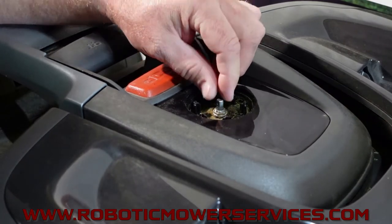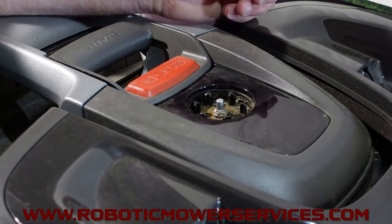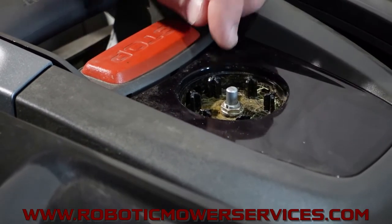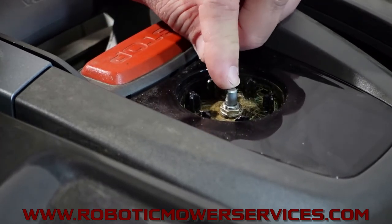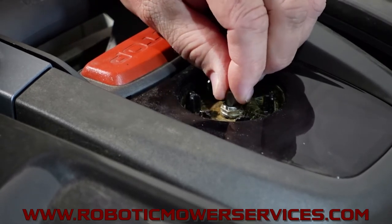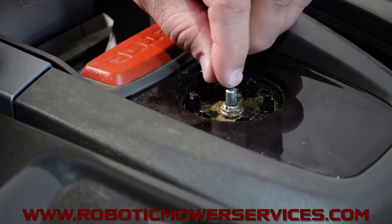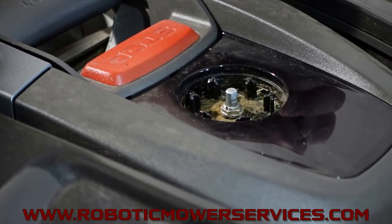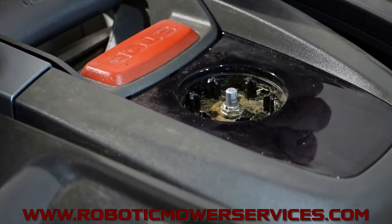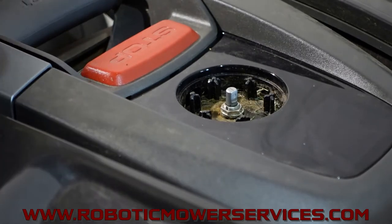You can see it working, but when you get it turned to just the right position, it goes down but does not come back up. Let me zoom in for a better view. You can see it going down and coming back up — but spin it over here and now it's not coming back up. Not coming back up again. In this case, the switch needs to be replaced.